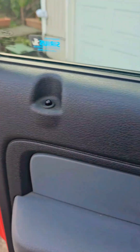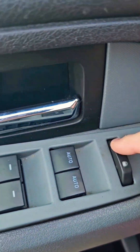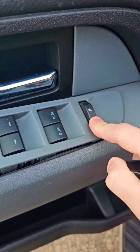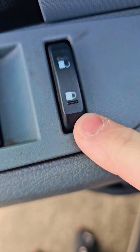Demonstrating the mismatch behavior of the body control module: pressing lock unlocks all the doors. If you manually lock one door by hand and press unlock, nothing happens — which would be the reverse if the wires are reversed. Again, by manually locking one door and pressing the lock button, all the doors unlock.